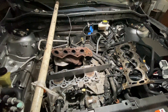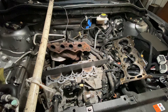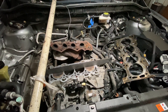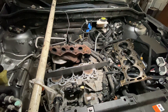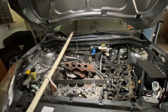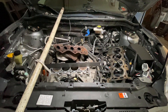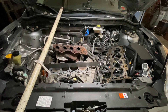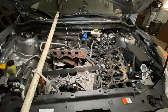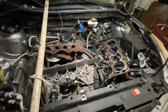So I'll mill the head, put a fresh gasket on with new head bolts, torque it down in the proper sequence, and we should be good to go with this car. This is Motor Car Nut 2020 — please subscribe. I have a lot of videos coming in the future, just building up the channel and trying to help people out and save them some money. That's what I'm all about. Thanks a lot, see you next time.